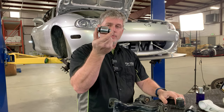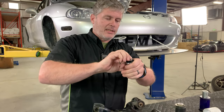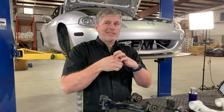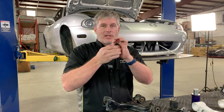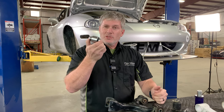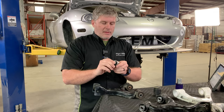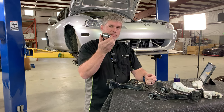That brings us to these spherical bearing inserts. The nice thing about these is that they allow for all sorts of misalignment easily without any binding. They don't have any spring rate. They can rotate nice and easily inside. So you don't have to worry about the spring rate of the suspension bouncing up and down. There's absolutely no slop in this — it's basically metal on metal, probably a little bit of Teflon in there. They're sort of the ideal of all worlds. They cost money — it's always that — and they take a little bit more to install, but they're actually a very good option.